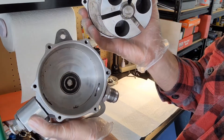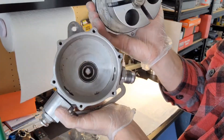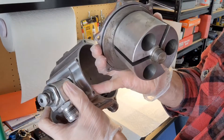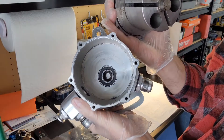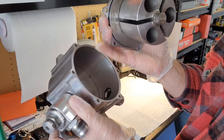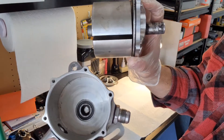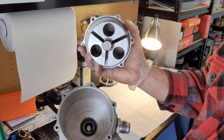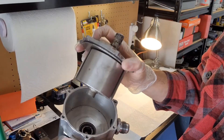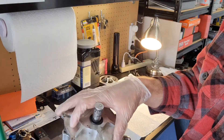When you take it off, you get kind of this inside. For the most part it's pretty clean — there's a little bit of stuff I've got to clean out and you can feel it's kind of scraped up in there. I'll try to clean that as best I can. The vanes have already pulled out but they go in these little slots here. This is a three-vane unit, so I'm going to work on finishing cleaning it up and then we'll put the rebuild kit in and see how we do.